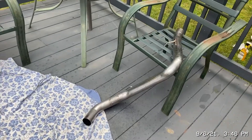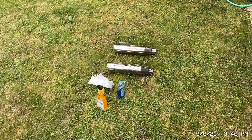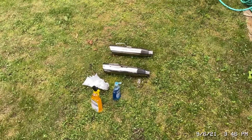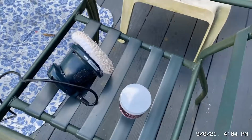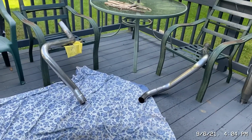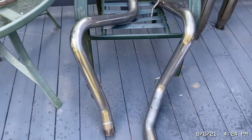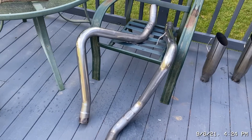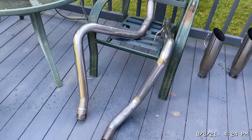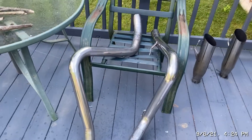It's time to polish. I got them as clean as I could — I'm not gonna sit out here all day. It's four o'clock and I'm trying to get the couple spots of tar off with the Goo Gone. I should have gotten bug and tar remover, but we'll see. Next I'm putting some polish on the applicator and working it on the pipes. That's about as good as I can get these — you can still see the lines up close, but they're much better than before. I emailed pictures to my buddy and he said it's because they weren't mandrel bent. The expensive Bassani brand can't even be mandrel bent — I think that's laughable since their system costs so much money.